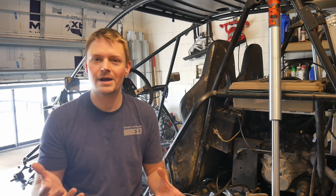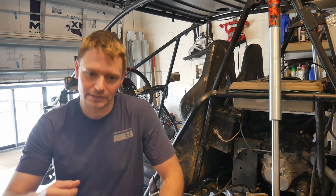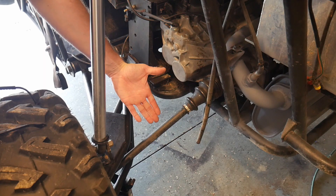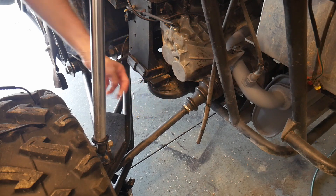The reason why the axles did what they did — and I knew this was going to be a problem, but I didn't think I was going to drive it hard enough to actually pull the axle out — let me show you guys what they look like. Because we put the new suspension in, these arms have more extension down lower than they ever have before. So we've got our limiting straps on the way.